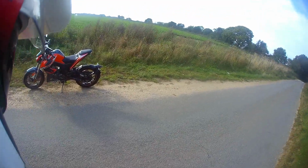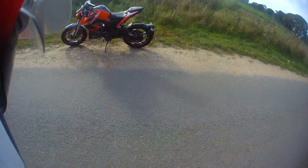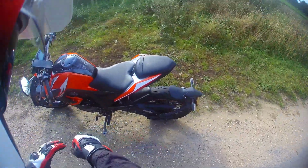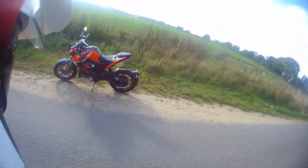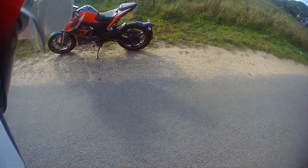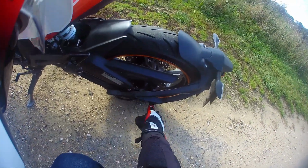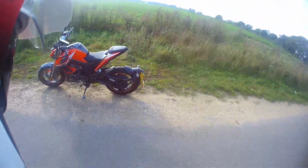The rear is kind of where I buggered it up. I didn't bugger it up properly, but what I did is this bit. So basically I put the bike up on its paddock stand. Before I done that, I actually undone the 3 bolts that hold this on. So you got this here, which is 12mm, 12mm, 13mm nut and 12mm. Take that off to get the number plate hanger off, which is what I've done.